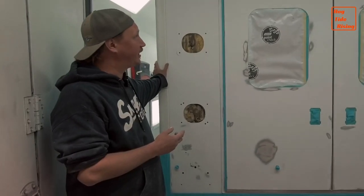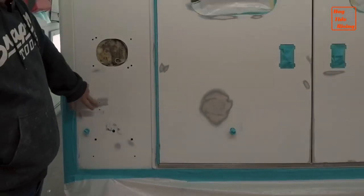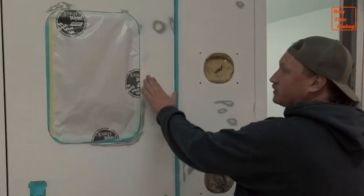I'm here at Felix Auto Body Limited in Calgary, Alberta with Button the Body Guy. Behind us is Oso the Ambo in the paint booth, ready to be primed prior to going over to Tyro Coatings for a hot sprayed polyurethane coating. Button explains that because the coating doesn't stick to aluminum very well, they have to prep and prime before it goes there. Any chips or imperfections are sanded out with 180-grit and then spot primed. There was a bit of corrosion so they put a bit of fiberglass on top of that, mainly feathering out any chips, scratches, or imperfections.